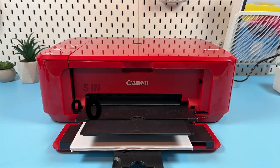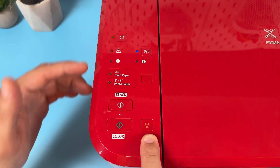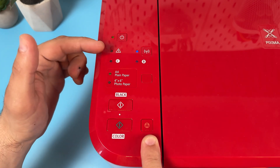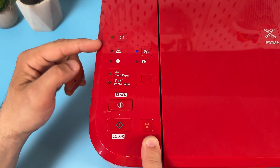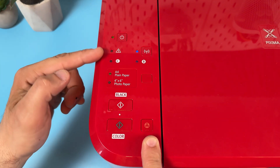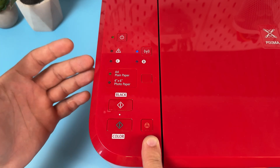So let's go. What you need to do for a hard reset: press and hold the stop button until the alarm indicator blinks 21 times. I do mean 21, because if you miss and it blinks 22 times nothing is going to happen, so you have to count. I know it's ridiculous but that's how it is.